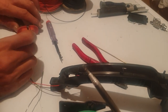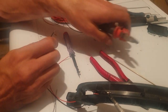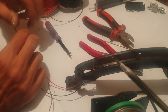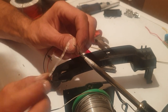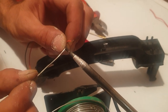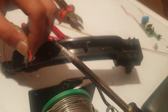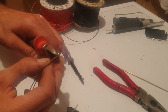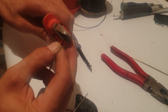So you now have your inner handle with your two brass rods and your two wires attached. Now you poke those through the hole, which will be your access hole into the body of your door. Then you get the other end, strip the wires back. These wires can be however long or short you need them to be — you could put the PCB somewhere else in the door. Positive and negative — tin those wires. Shake off the excess, then cut them to a nice size — about three or four millimetres. You don't want a massive amount of overhang.